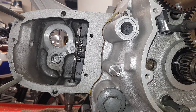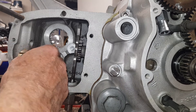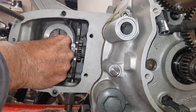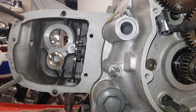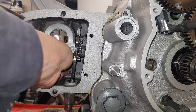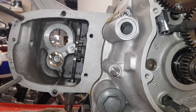I'm going to assemble the gearbox on camera, which will be difficult because the camera wants to be exactly where I want to be. First thing: I'm going to put the thrust washer in over the needle roller bearing on the lay shaft at the back of the gearbox. There's a little pin that holds it, and it sits around the needle roller bearing — that's why the needle roller bearing needs to sit slightly proud of the housing.